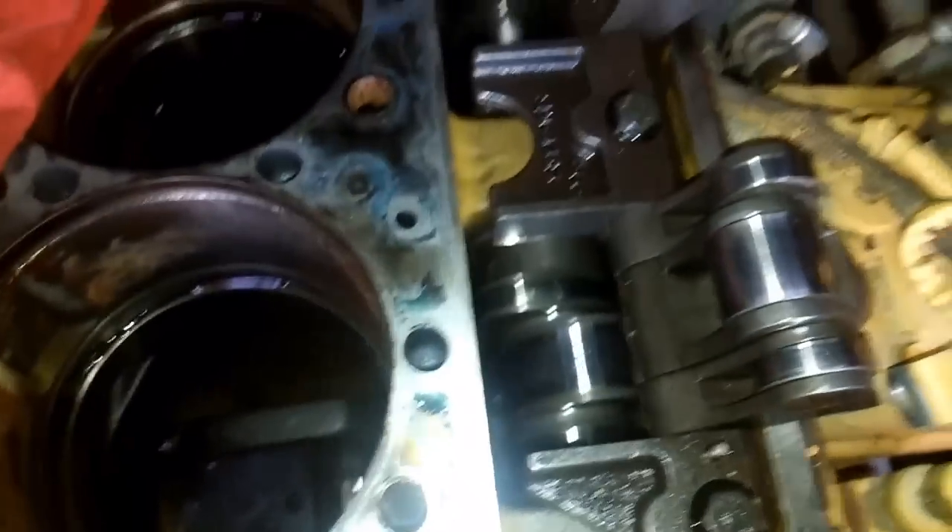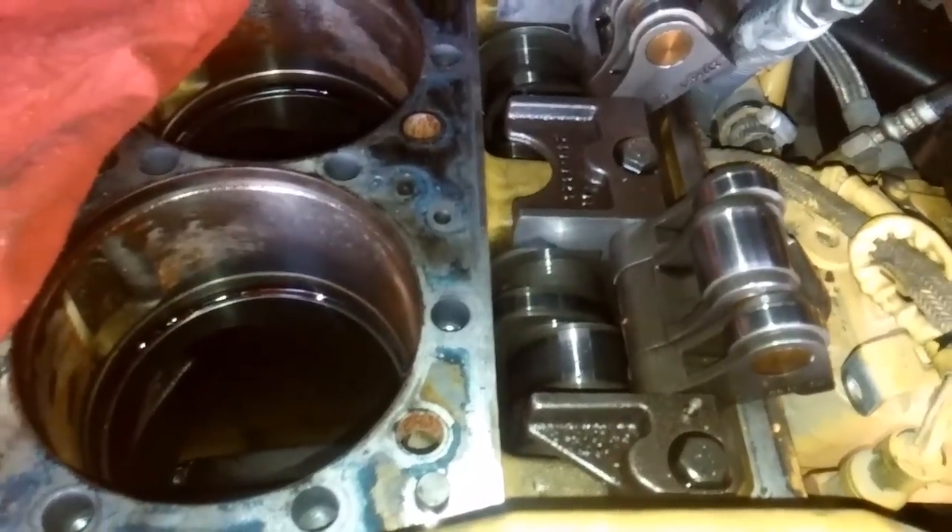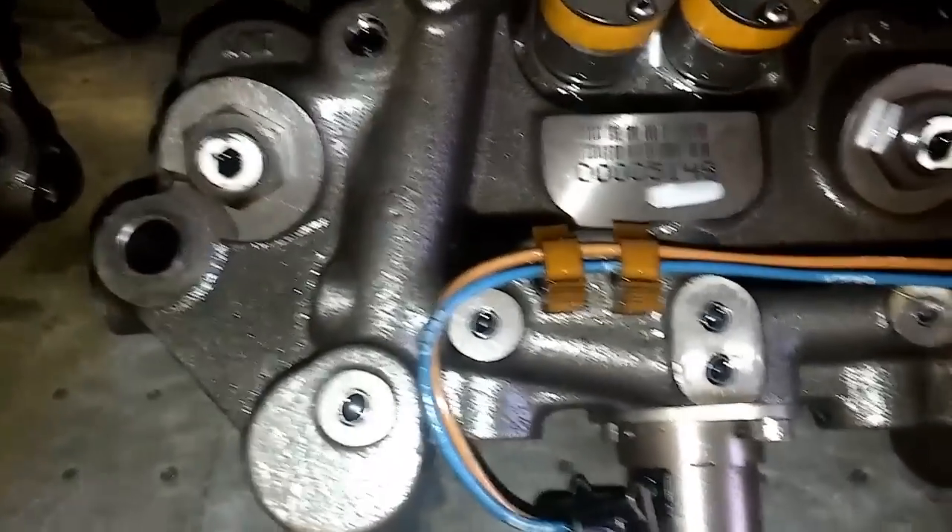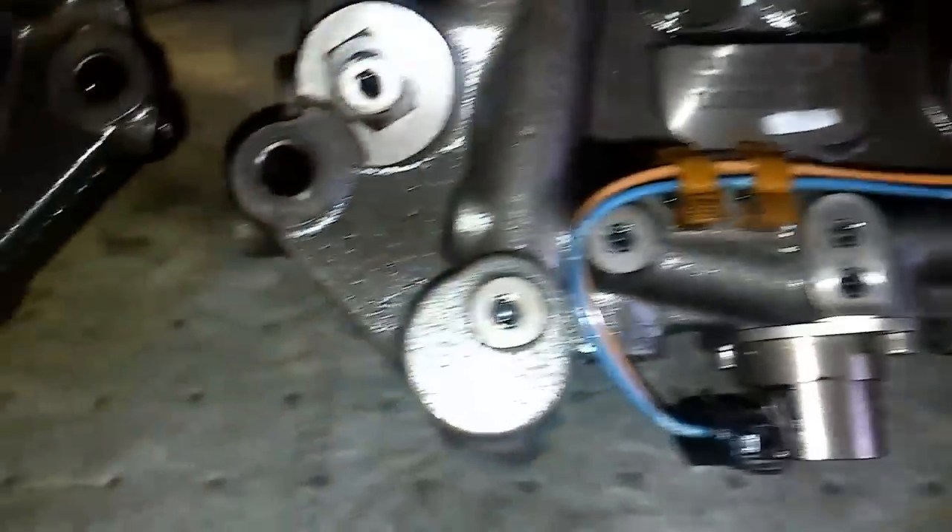We have your turbochargers, and the lower turbocharger has your wastegate. Here's one that is torn apart - a C13 with the head off. These are your roller lifters and your camshaft. The head's been removed, so if the cam had to be removed you'd have to pull that little cover plate off. This is a pushrod engine, so you have your push rods. The intake and exhaust push rods are the same, but the injector push rods are much thicker and different. These are the injectors. You have your IVA/Jake housing and your rocker arms.